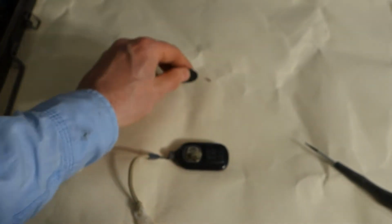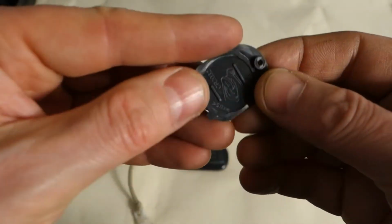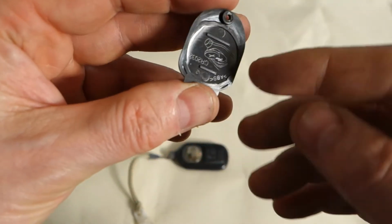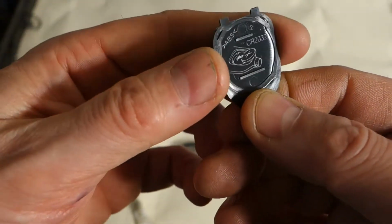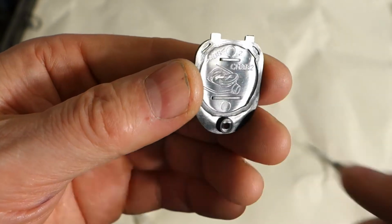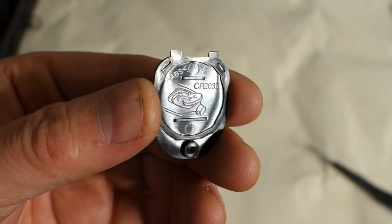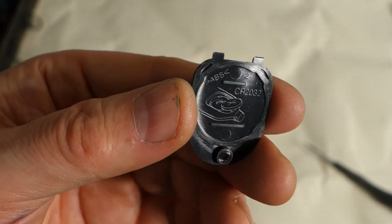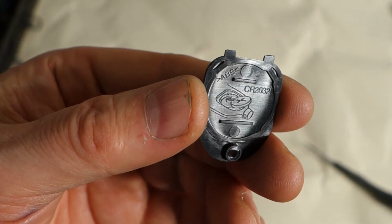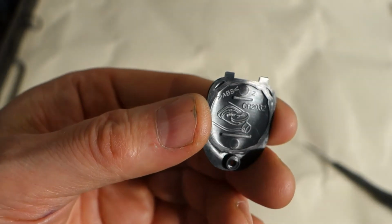And then if we have a high quality step meter like Omron, in these high quality step meters there is information on the back cover about what the battery's type is, CR2032, and also information on how to install the new battery in there. The idea is that plus is up. Okay, good. This is excellent quality.